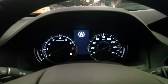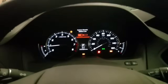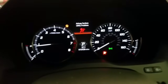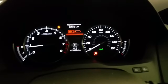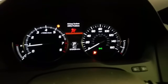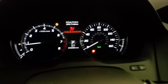Now I'm going to go start the car and see if anything changed. I'm back in the car — as you remember, all those lights were on. Let's start the car. My camera is a little blurry but as you can see, every single light went off except the airbag light. The airbag light is on for a different reason — I need to replace a module. This car has been in an accident, the bags were deployed, we replaced the bags but still need to put the new module in. All my lights are completely gone — SH all-wheel drive, ABS, traction control, brake — all gone because of one simple fusible link.